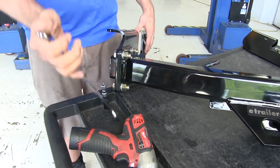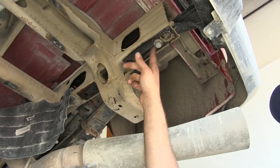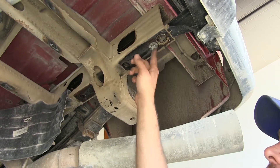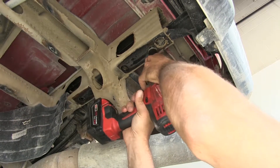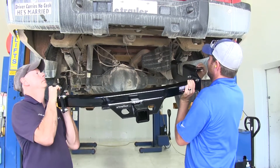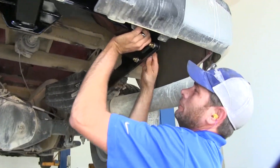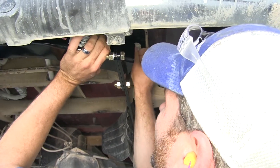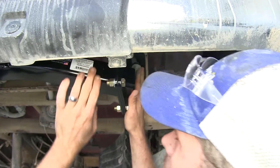Do that for the other side as well. Now on each side of our frame rail, there's going to be an M14 bolt in the very back. Our customer already removed his hitch out of here just to give us some room. We're going to get those removed on both sides. Now with an extra set of hands, we'll get our hitch raised up into position. The forward attachment point in the flange — we're going to replace that 14mm bolt we removed on each side. Once we have that threaded in with three or four good turns, we'll just let our hitch rest there.